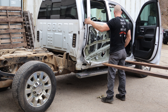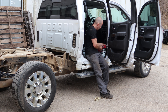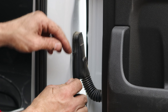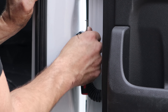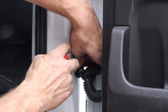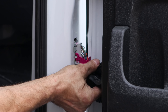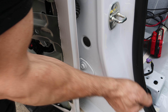Now it's free, but the door panel is wedged in there on the other side, so I just had to pry it around. It's no good anyway, so it doesn't matter if I mess it up. Take the door check out so we can close the door to take it off. Now we're going to disconnect the door - pull the rubber boot out, work it out around the black plastic. Push the tabs up on the top and the bottom, then pull the pink tab down and that releases everything. Now we can unbolt the door.